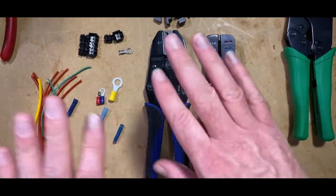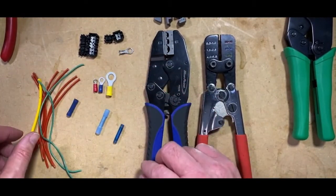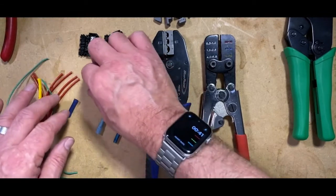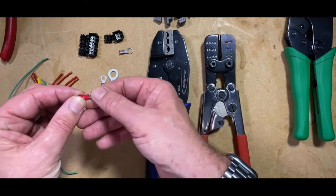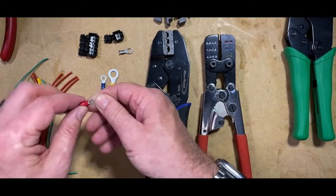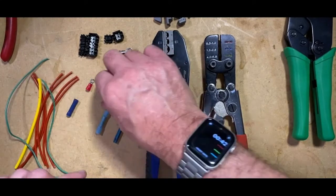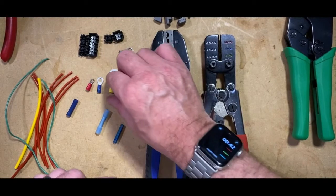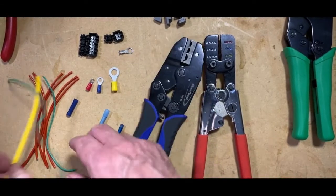So, going back to these connectors, we talked about the gauges of the cable. As it says in the demonstration on our slides, the smaller cable is for red, the blue connector is for the medium-sized cable, around about 1.5 to 2.5 millimeters, and then the larger one is for the larger gauge cable, like so.